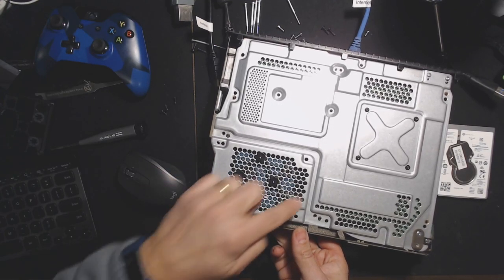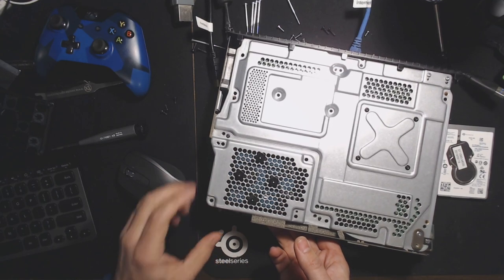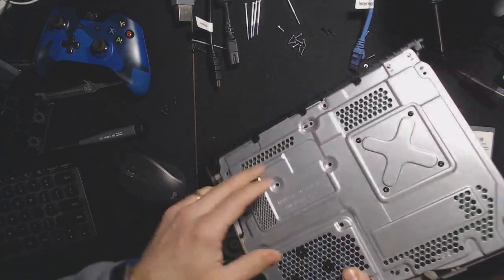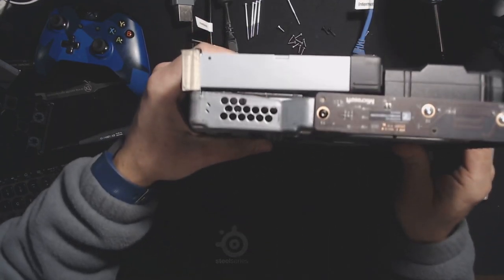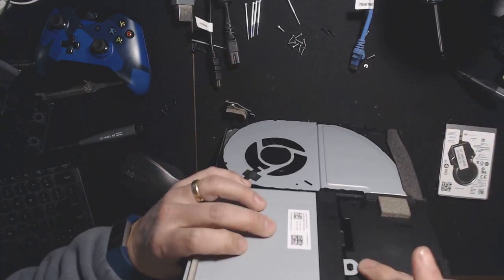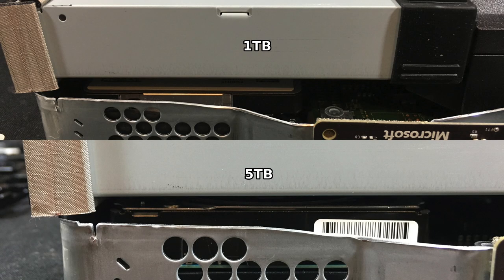Although I would recommend putting the additional three screws in the hard drive to the caddy — I forgot to do that, so I'll do that off camera. Make sure you put the four screws back in on the hard drive. At this point we should be able to test the system. I'll show you one more shot at the end to show that I can get the case back together again. I'll also show you a close-up of this solution. Now you can clearly see — even though it's a little blurry — there's space between the hard drive and the optical drive. There's not as much as there was with the original 1TB drive, but there's enough that the breather hole won't give you a problem. As long as it's able to get some air, that's all it needs.